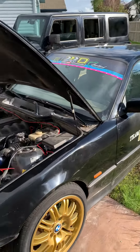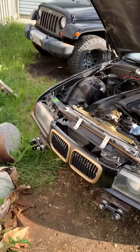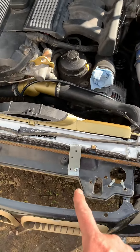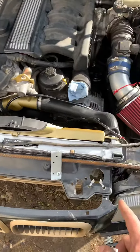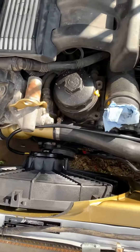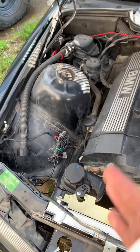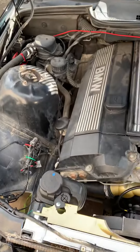A little bit of progress: the front grille is back on, headlights are on. I trimmed the top of the fan shroud a bit and fabricated some brackets clamping the radiator to the front grille against that reinforced rebar to keep it nice and sturdy with clearance. I also had to move the radiator reservoir back and fabricate a better mount because it was hitting the hood — it was too far forward. It's still a pretty tight fit but keeping things snug.